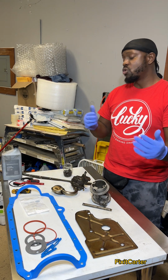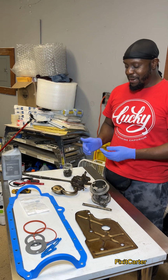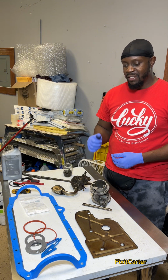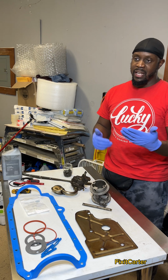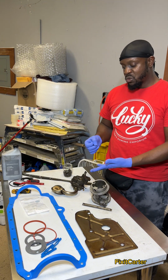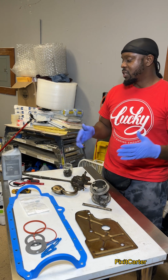So, guys, if you got your oil pan down, just make sure you're taking additional steps to, one, service the oil pump. Most likely, the oil pump is going to be an issue. Not in this year, not in this generation. You don't have the issue with the gasket because it doesn't have a gasket. So if you're doing it in later generations, you have a little seal that's responsible for the oil pressure issue. With this one, I think the oil pressure issue was due to the screen being clogged up. Do yourself a service, take it down, get it all situated.